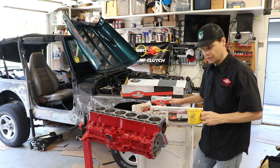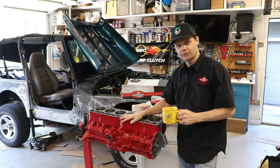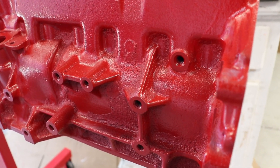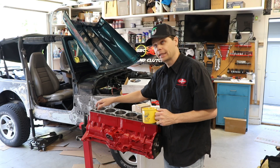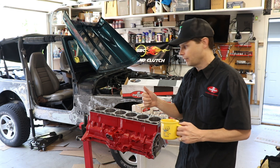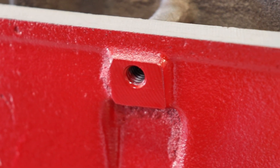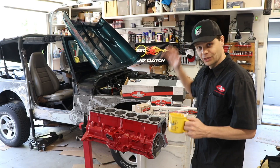Before we can start installing all these parts, even though this came back all nice and pretty from the machine shop, we're not quite ready for assembly. We need to take some wire brushes and clean all the threads where everything bolts onto this, because a lot of those parts ground to the block itself. I did run into an issue on my last build where I didn't clean that ground well enough — after the rebuild, it wouldn't fire up. Finally narrowed it down to the ground not being good, and when I cleaned it, it fired right up. Also got to clean the recesses where the core plugs are going to go, and then we're going to pressure wash it.